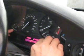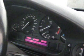The option that we're going to do is the voltage on this one, and system voltage is test number 9. You go through using your right control button, hit test number 9 and select it to see what your battery voltage is at terminal R, or the ignition on without it running. You can also test the voltage at the next level to see how it affects your battery voltage.